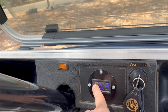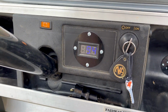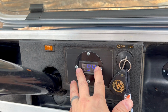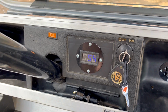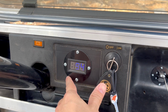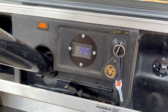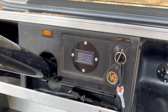And the problem is it's got this tiny little lip, right? And so unless you feel like you can cut a perfect rectangle into your dashboard the first time, then you need to have some kind of mounting plate for this. I am pretty good at cutting things, and I was like, there's no way I'm gonna be able to cut a perfect rectangle that's the exact right size for this. So I created this mounting plate. Now, in my opinion, something like that should ship with the kit. Something like that is necessary. Then anybody with a hole saw could mount this.